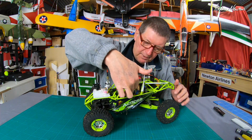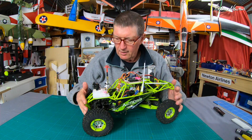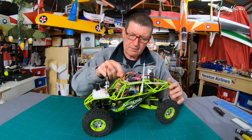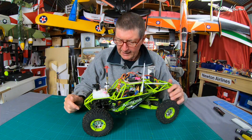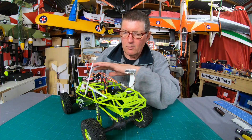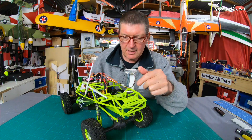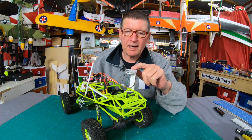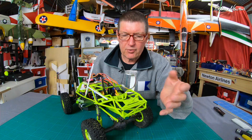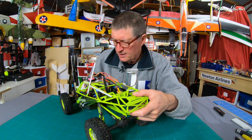This buggy also comes with a gear-changing servo, which stripped out very early on, so I've got it locked in one gear. So really all you have is throttle and a steering servo. I've got the GPS and compass up on a little mast made from heat-bent PVC plastic to keep it away from noisy or metallic areas. I'm running it on a 2S 2200mAh pack; it only draws about 5 amps cruising, so no special batteries needed.